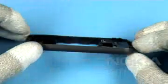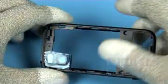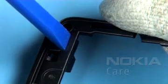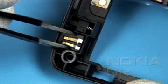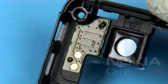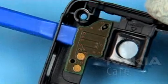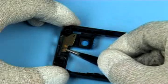Turn the D-cover and simply let drop out the antenna IHF assembly. Push out the DC jack partly — now it can be lifted out easily. Lever out the flash assembly. Keep the adhesive clean if this part should be used again.